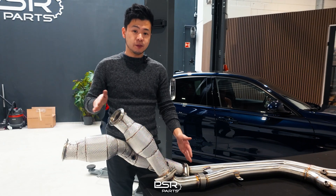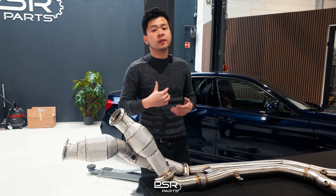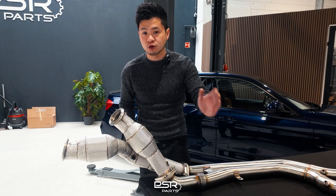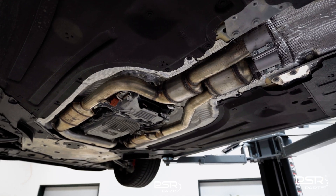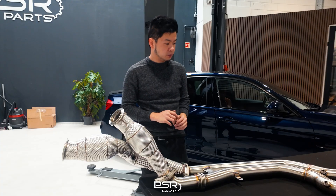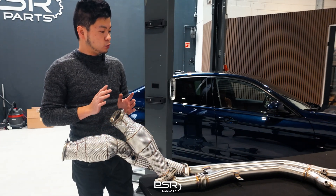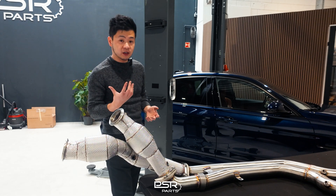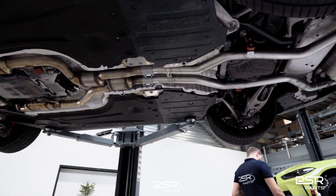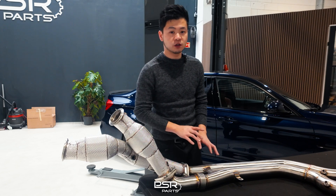It's the length difference between these two downpipes that we need to compensate for in the exhaust behind them. There are many exhaust options for these cars — you can use the original BMW principle which splits into two exhaust banks, where the exhaust pulses mix further down the line. We chose a different principle to save some weight and keep things simpler. But first, let's explain why BMW chose an exhaust that splits into two banks. This is still a two-pipe principle but different from what BMW uses on the G80.